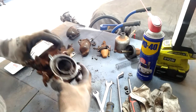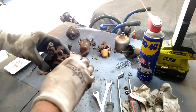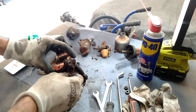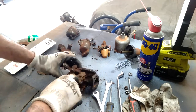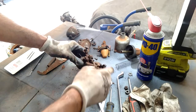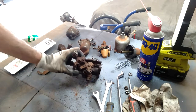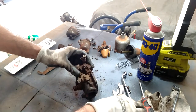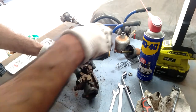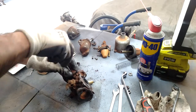The next things to remove are the mechanism for the choke and then the butterfly valve. Just undoing these two we'll remove it. On the accelerator or throttle piece there are a couple of little tabs you need to just push down — you don't have to belt them with a hammer.